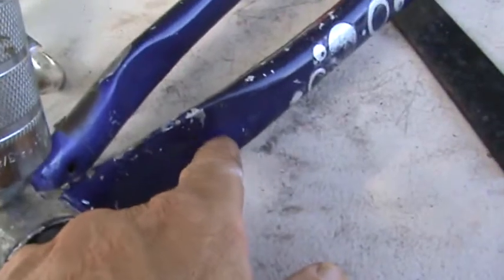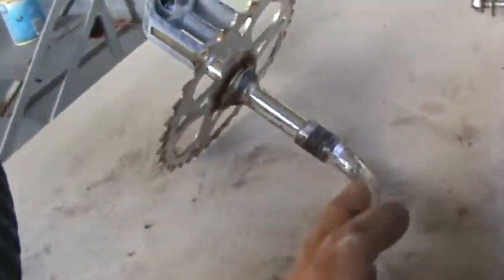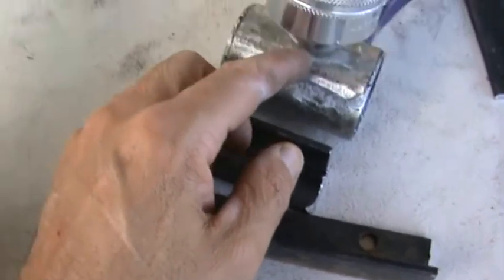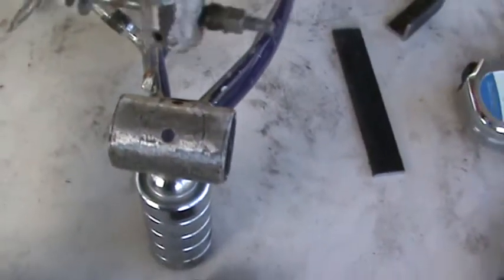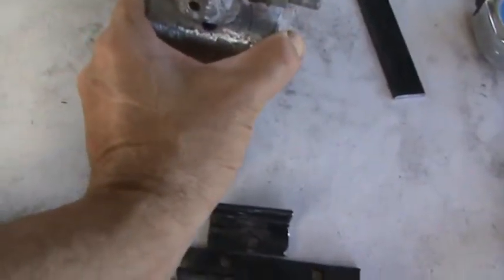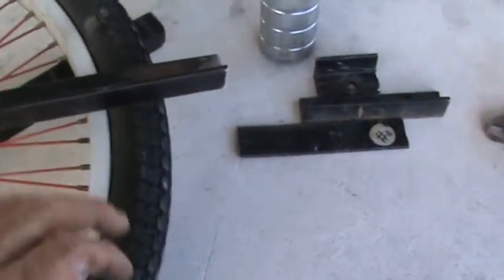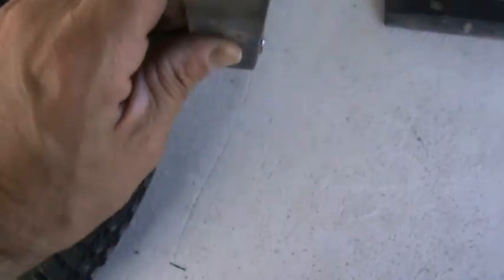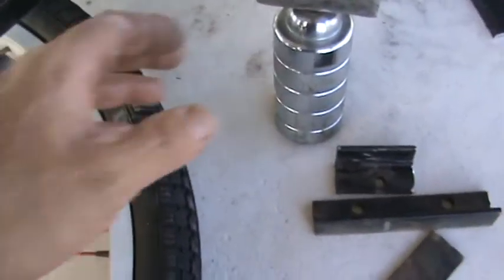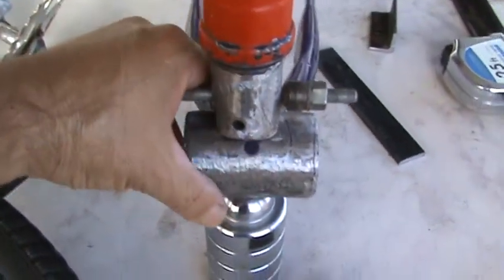I'll be able to bolt the front end together with angle iron, which is a lot stronger than this — because this one already broke on me. I was trying to adjust it to get it under the wheel and it cracked on the inside, so those are gone. The only thing I'm gonna use is this round thing, just for the crank arm assembly. I still gotta figure out how to get this to the gooseneck bolting without welding. This front axle — I can do that with bolting together, no problem. Drill holes in the angle iron, put locking bolts so they don't come undone — it's gonna be really strong. Bike's gonna be heavy, but it's gonna be strong.